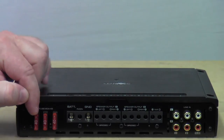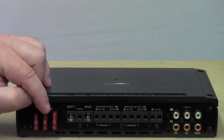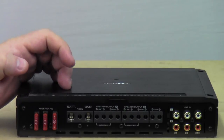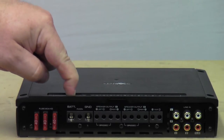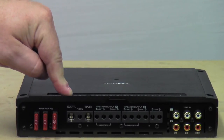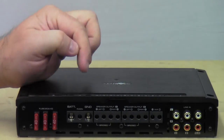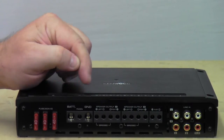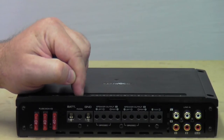This amp has three 40-amp fuses. So you know this amp means all power — it's got 40-amp fuses and there are three of them. Right here we've got the battery input; this accepts 4-gauge wire. I would put the best 4-gauge in there — spend a little extra and get some real 4-gauge power wire. And right here in the center between the battery and the ground is the Pcon, or power connection, or remote turn-on. That's what turns the amp on.